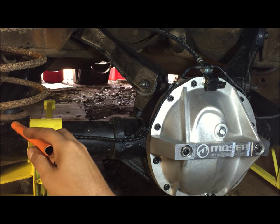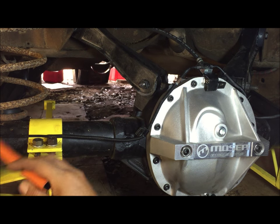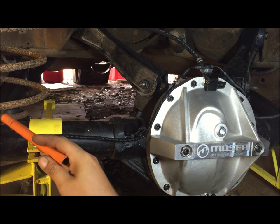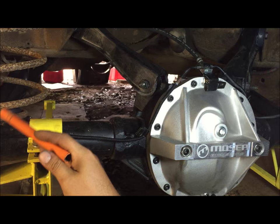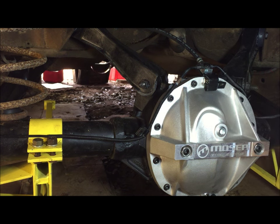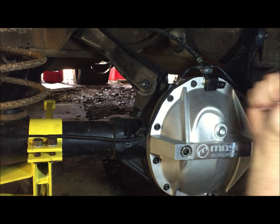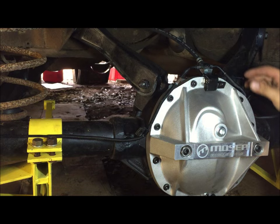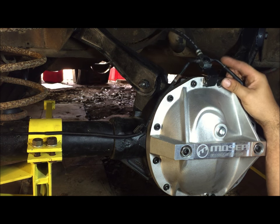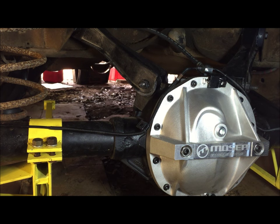What we're gonna have to do is put a little perch here for the rear disc brakes. This brake steel line — we're gonna reflare it and change the nut over here to convert it and modify it where it stops. This is the first part. Since we're down here, if you're running an aftermarket cover — which I would suggest — go ahead and buy it. It looks badass and feels badass. The problem is this three-way fitting right here eliminates the place to mount it, so that's what I'm going to show you.